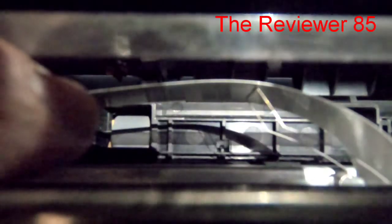Hey, what's up guys. So when you're having the paper issue on the HP Officejet 3830 — when the paper doesn't want to slide down — it's because sometimes the rollers are dirty. So you open the front where the ink goes and you have the two rollers, as you can see, towards the back.